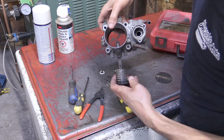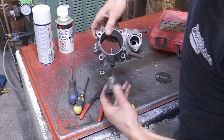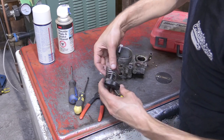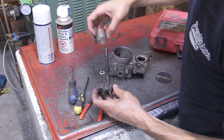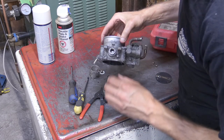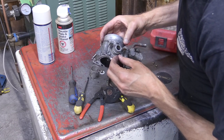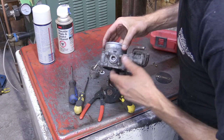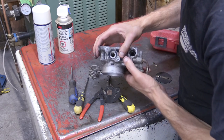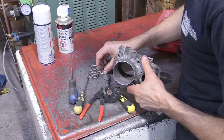And the seals that people change are actually still in the throttle body itself. They're not on the shaft. They're on either end of that throttle body. And I believe those seals need to be pressed out. Another good question for people watching this, since I haven't done it yet: if you've ever replaced the throttle body shaft seals on your EVO, leave a comment, let me know how it went, and let me know if you have to press them in or if you just tap them in with a socket or something.